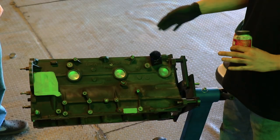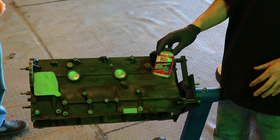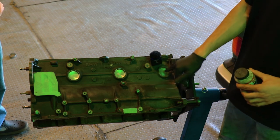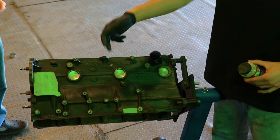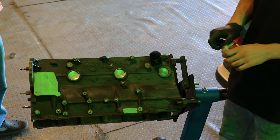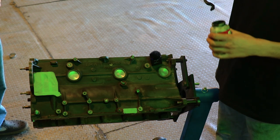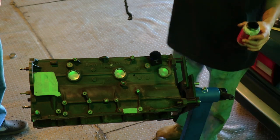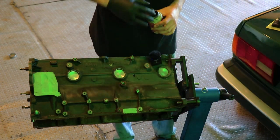So now the engine is basically ready. We're gonna go in with some brake grease. The reason we don't use tape on something like a freeze plug is because it's just kind of hard to tape and you're never gonna get it perfect. Grease is a little easier because you can kind of just put it anywhere and the paint won't stick to it, and when you're done you can just wipe it off. So I'm gonna go ahead and apply this slowly.